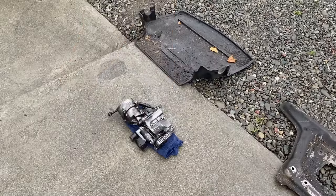For all you torque Nazis out there: 22 Newton meters. Now we can take our 19mm and snug these banjo bolts up. Slap our oil filter back down.